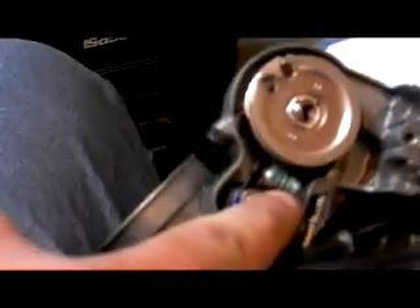Here we are with the next step in the JD jetting kit — that's to wrap an o-ring around the throttle mechanism, specifically the pump actuator. Here's how it should look inside the carburetor: there's literally an o-ring that wraps around the little lever there. It kind of pulls it a little bit faster when you accelerate. It's a bit hard to get on there — I used a tiny screwdriver and just worked it around.